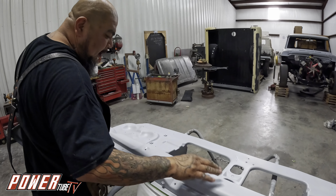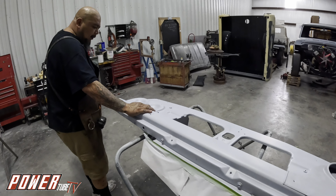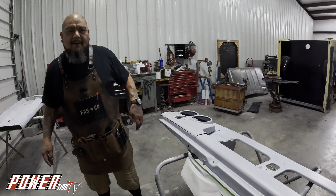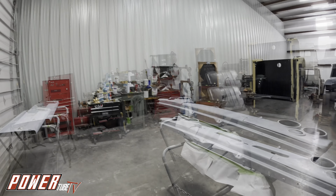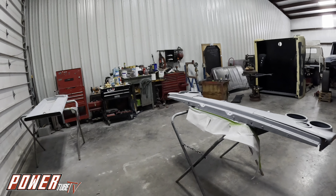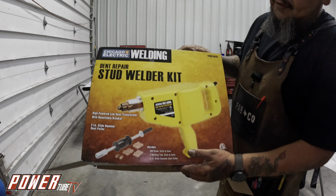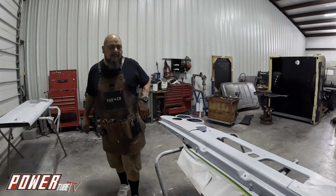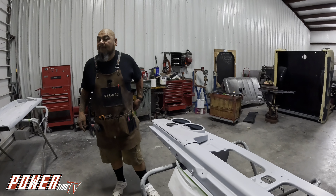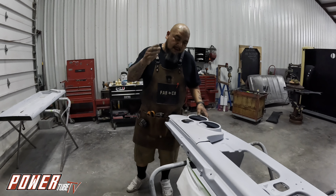The radiator support itself is body worked — got that big dent fixed. Y'all remember I cut it out, beat it, welded it back in, pulled some dents there and here. We went back to Harbor Freight and bought a stud welder kit, and once we bought that we were able to pull some of the smaller dents a little bit easier. It really helped with the tailgate.